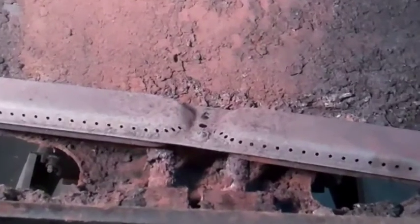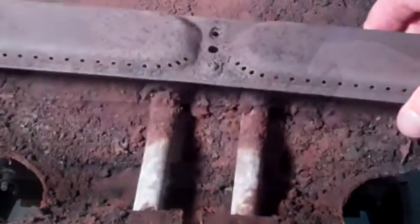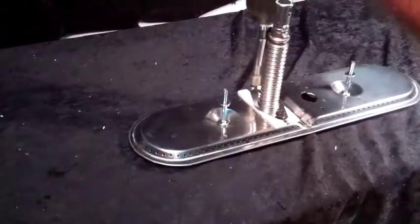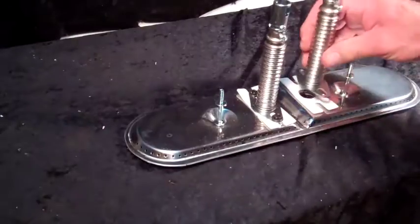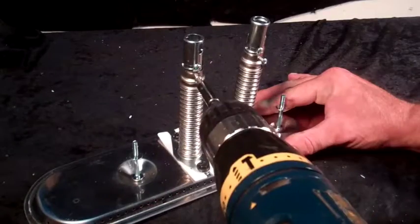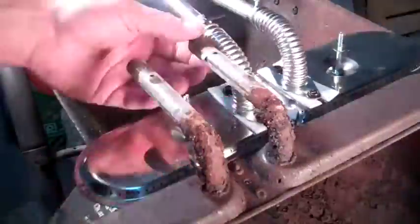The burner lifts out of the barbecue by rotating away from the control valves while lifting. We'll build a similar oval burner replacement and visually match the gas tube angle and length to corrugated adjustable venturi tubes with extensions to slide over the gas orifices.